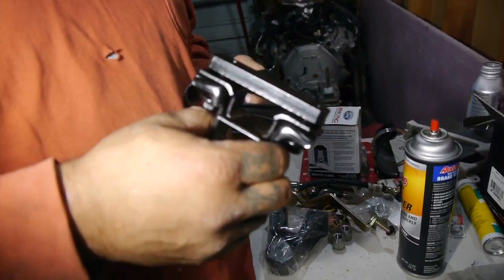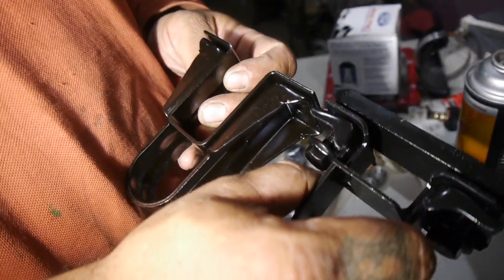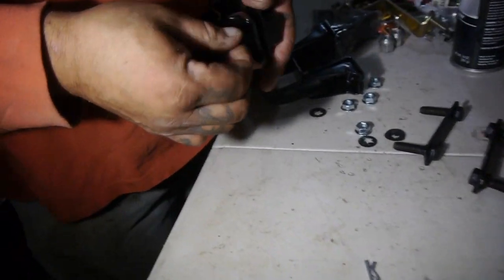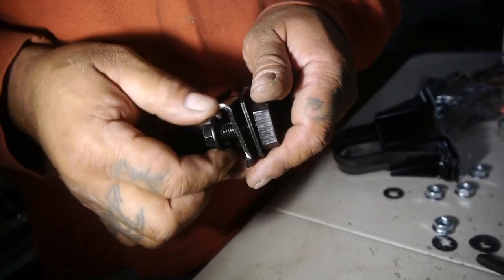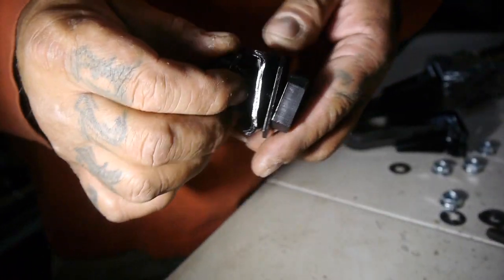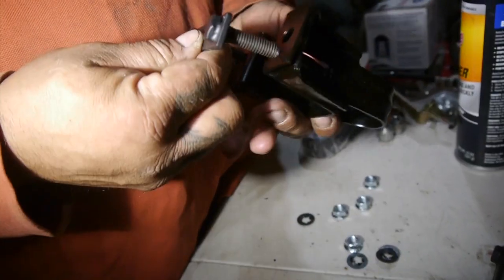We initially probably just needed an extra inch to give us enough room for the alternator, the AC compressor, and the oil filter - but this new kit definitely has more than an inch drop and it's definitely going to clear. The difference between these two kits: the old one has a removable bolt with heavy gauge steel on top threaded for the bolts. The newer LMR Coyote kit has the bolts already on a bracket.